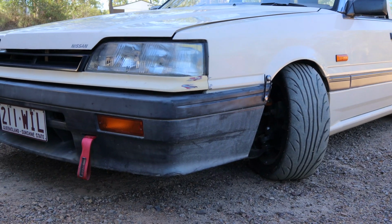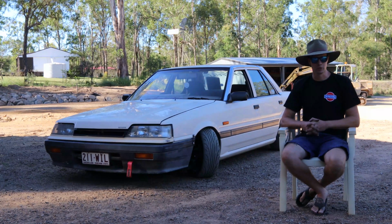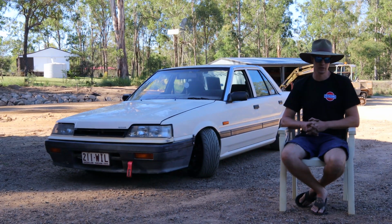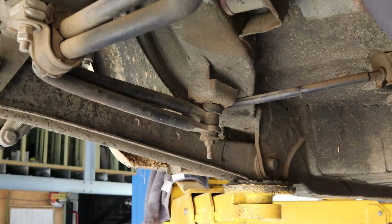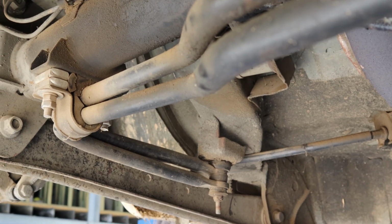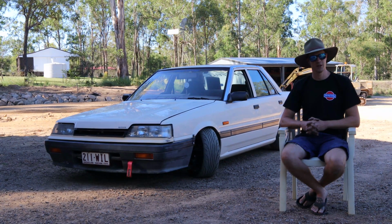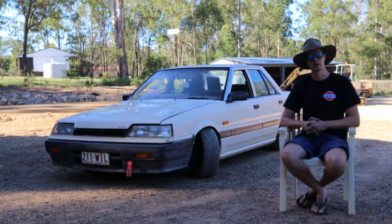So starting at the rear, we've got a four-corner 78, the 28 spline 4-pinion R31 Skyline diff, 3.89 ratio that's been welded, so it's rock solid. Rear end, we've got a dual sway bar setup, so twin doubled up stock sway bars, which keeps you nice and stiff. And we've also got Max Speeding Rods China eBay coilovers, which thus far I've definitely put through their paces and have not been able to break them. So actually pretty happy with those.